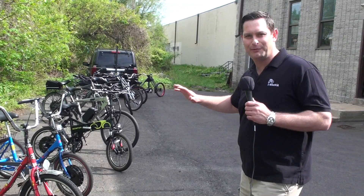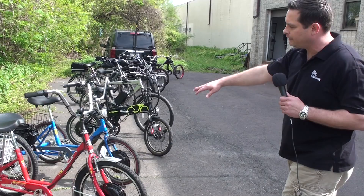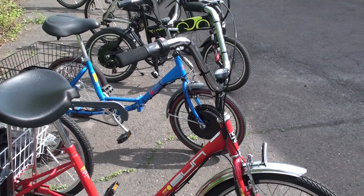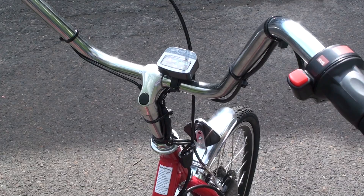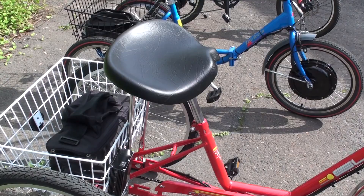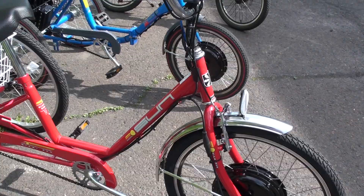Here we are outside the E-Bike Kit headquarters and we have a bunch of bikes. We heard Pete and Court were coming to visit, so we just converted everything in the shop. You can see a full line of bikes. The first two here — we have a Miami Sun tricycle from JMB Importers, who were kind enough to give us this bike for today. This has the eTrike Kit on it, which is our tricycle-specific conversion kit. It's got a lot of differences that make it perfect for adult upright tricycles — a heavy-duty pulling front motor, limited top speed of 12 miles an hour forward, and reverse at four miles an hour. We've got a 36-volt 9Ah SLA battery in our bag in the back. This is really for seniors, which we've found to be the biggest market for us — senior mobility at its finest and most affordable.